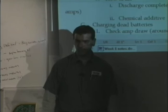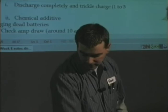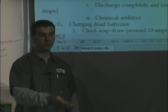So you're driving along, car's fine, shut it off, go in and get a hamburger, come back out, and your battery's dead. Well, in transport, you jostled it around, and that lead kind of swished itself up, touched two plates, shorted the battery out, and killed your battery instantly. That's one possible explanation for why it would do that to you.